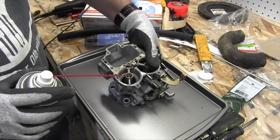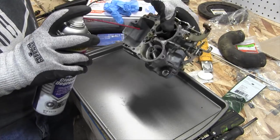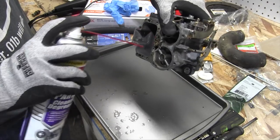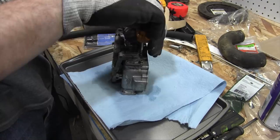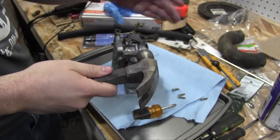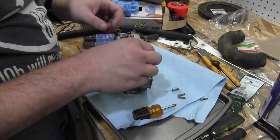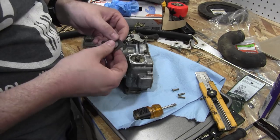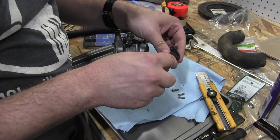As I mentioned earlier, it's a shame I didn't do a pre-op inspection of this carburetor to find all the dirt inside of here. It would have saved me some trouble now, but it's irrelevant, because now it's off and I'm cleaning it. I hope this accelerator pump is fine, because I don't have a replacement. Gingerly. Oh God, there's shreds of stuff in here. That doesn't look good. It's not a new part, that's for sure. It is dry and cracking.